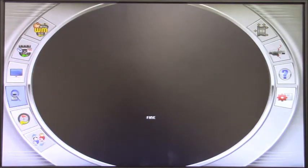We have a fine reading function where we can quickly see the imbalance in very fine reading — gram by gram or a tenth of an ounce at a time. Display logo takes me back to the main page or screensaver. We have a counter — with this program we can see how many wheels have been spun daily, weekly, or over the total life of the machine. We have a weight management program that helps us save weight without compromising the balancing of the wheel.